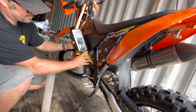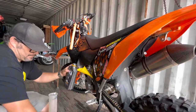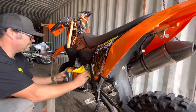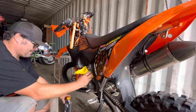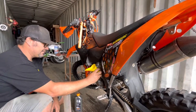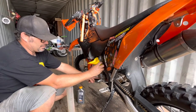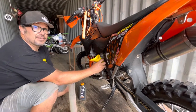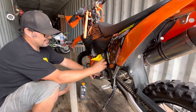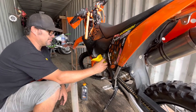This is going to be interesting. Okay, so some people on YouTube talk about not necessarily going with the manufacturer spec for the engine; they overfill it a little bit. And that's a little more important, especially on motors where you're feeding the crank. If the crankshaft side is separate, they probably do overfill it a little, maybe put 0.7 or 0.8 in it to make sure that it never gets too low when it's under high revs. But for the transmission side, you should be able to fill it to spec.